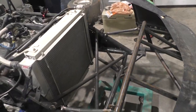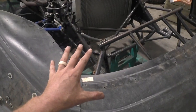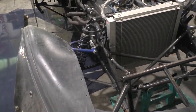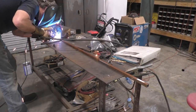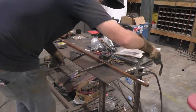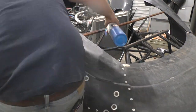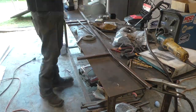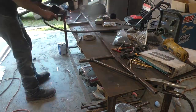Got to build a new T-bar — ran out of talent and completely scuttled the left front. I mean, it's gone. So I've got everything cut up for that. We're going to get that done, get our hood filler piece on, our nose filler — whatever you prefer to call it — and then we'll get our mock-up hood on, which will allow us to measure for the top of our rear quarters sheet metal. You could buy these T-bars fairly cheap, but a three-quarter stick of square tubing is pretty cheap, and you can make multiple T-bars out of it. You can choose the bend you want on the right front fender or just copy your factory one — save yourself some money, learn something new.